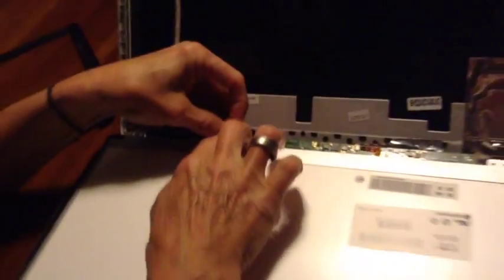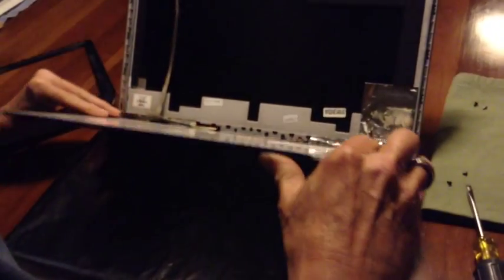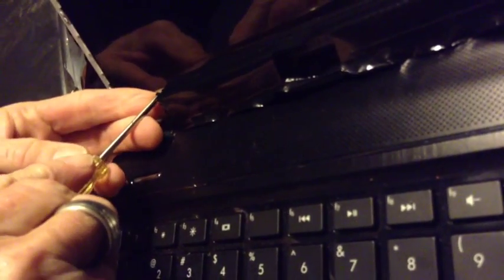And you need to start to apply the new one by connecting that webcam to the top and then connecting the connector pin to the new screen down on the bottom. So if you lay that screen down on the keyboard, you can connect the old pin and then line everything up and place that back up. You then need to put the screws back in to screw the screen in place, so you can do the bottom right and the bottom left, and then you can move on to the top two to keep it in place.